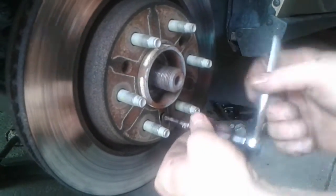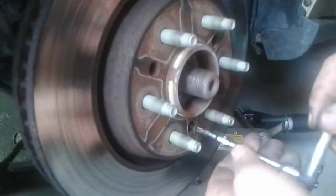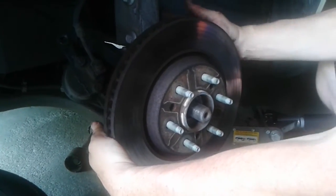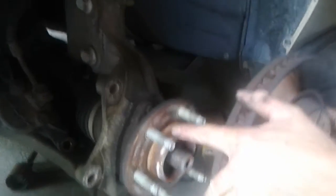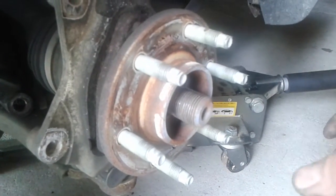You've got to remove that set screw. Sometimes they're really hard, so you might have to use some penetrating oil. Take that out — it's just a set screw. You're going to have to get a hammer. Now you remove it. It's seized up — see how you should put some anti-seize in there so this doesn't freeze up. We'll do that.